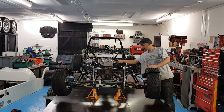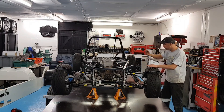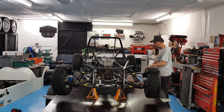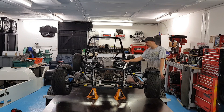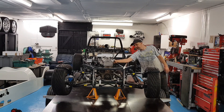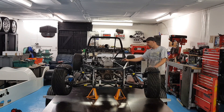And that's everything bolted up. You just saw me make the aluminium bush for the back we talked about earlier. So now everything's bolted tight to the block and I drilled the holes through to the engine plate. My new brackets are now mounted to the chassis as well. With the rubber bush it's a nice and firm sitting in there — everything's how it should be now. So it's actually taken me all day to make these engine mounts.